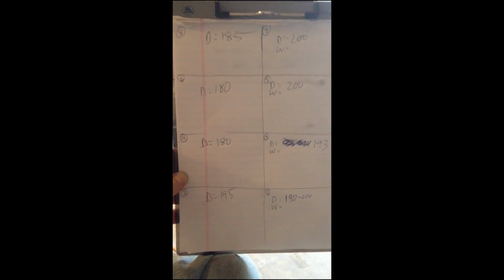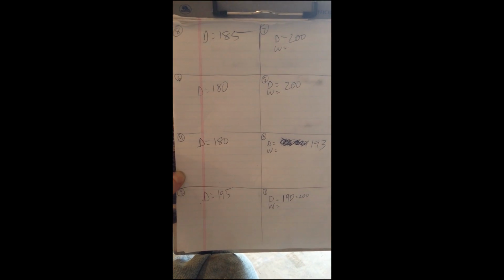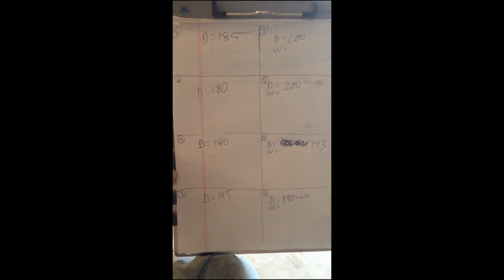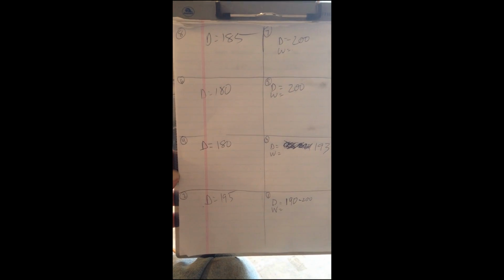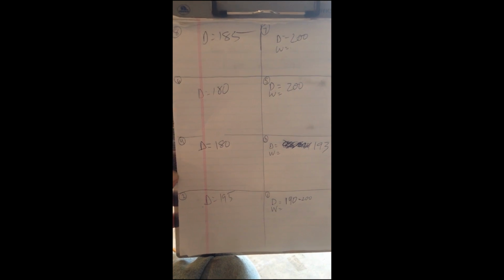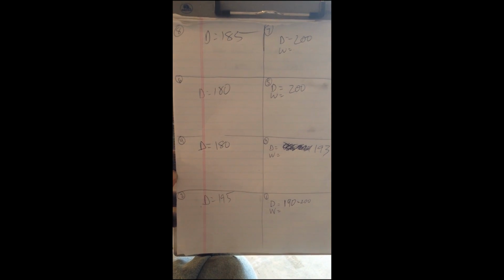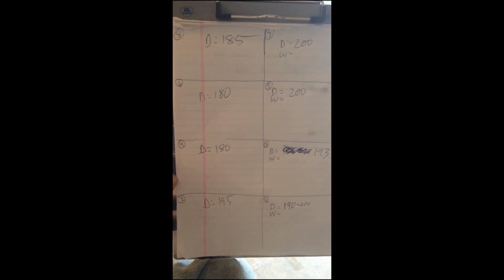Okay, as a video guy, I hate vertical videos. However, this is one case where it actually makes a little bit of sense. So here we are. We're looking at all the cylinders, and we're looking at the PSI for all the cylinders. Our highest looks like cylinder 7 at 200, and our lowest, cylinders 4 and 6, at 180, which, if my math is correct, is a differentiation of 10%, which is, I guess, in the range to not worry about.